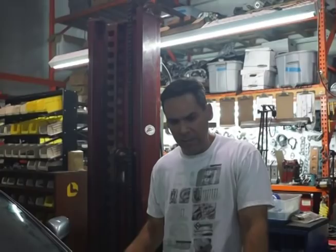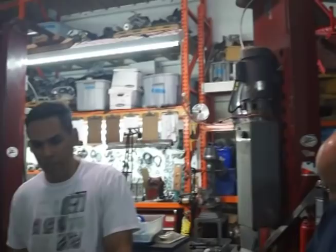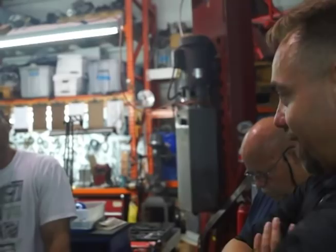Out of curiosity, this is me playing devil's advocate. If you were to put, let's say, a Haltech Platinum there and replace the factory system, could that be done? And not have to do half of this stuff? Well, electronically, yes. Mechanically, no, because that only solves electronic issues. You'll get it running, but you're not going to get fuel, you're not going to get tach, you're not going to get some of these gauges working. Really? Yeah, they won't work. They're in different ranges.